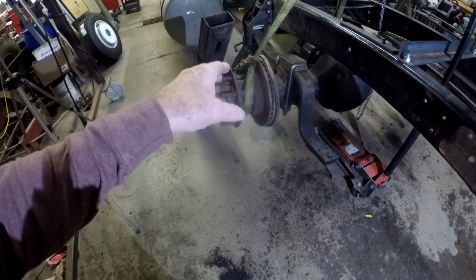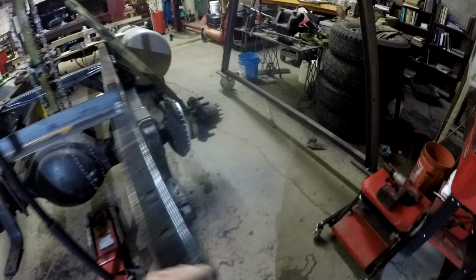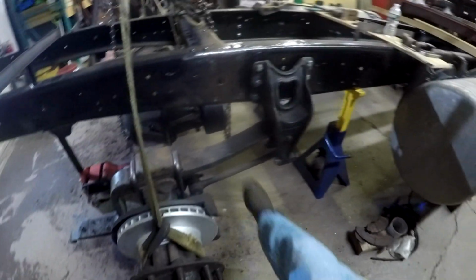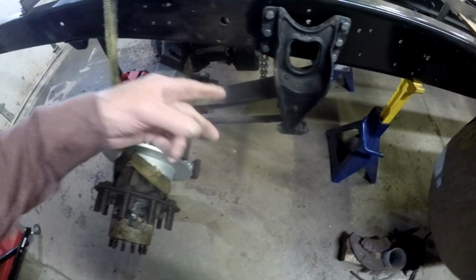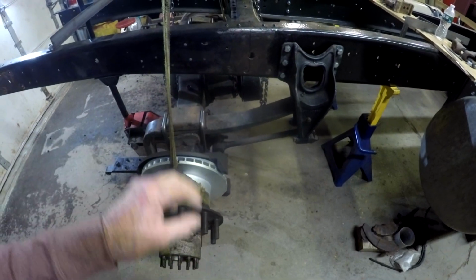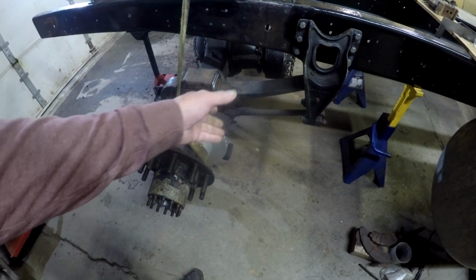So this whole thing started out about the brake calipers. We're not going to be able to get to that today. I've got the suspension on here, and let me just explain to you one thing. The entire axle is being supported or being positioned by this torque arm. That torque arm is a major support right now. These leaves are not supported. They're just kind of, well, I can't really move it because it's got weight on it, but that leaf is just resting on top of a nylon or a Teflon pad, it could be. So the positioning of it is exactly because of that torque arm.